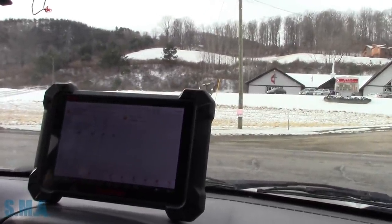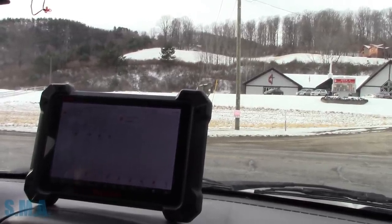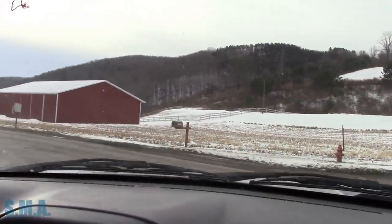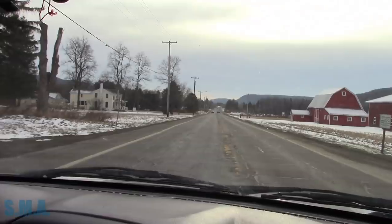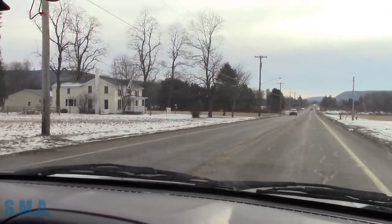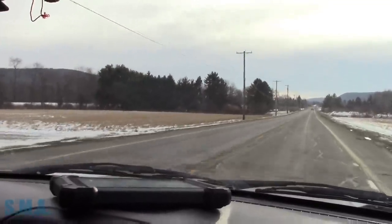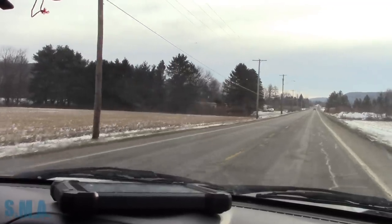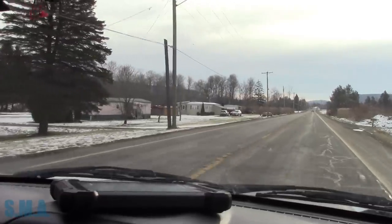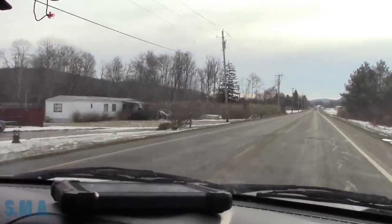And in my experience, I have found that when I tell the customer to drive it X amount of miles, which I don't do, but I find that customers that are told that, that's all they do. They go out driving with intention and just keep driving and driving, and they never meet the criteria, so to speak. The car doesn't sit because they just keep putting gas in it and keep driving, and it doesn't run the drive cycle because it hasn't had the proper number of cold soaks and warm-ups.